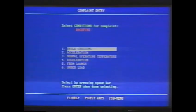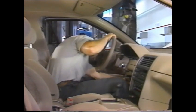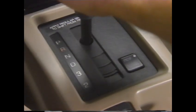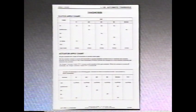actuators, and warning lamps. While the actuators can be checked using the service stall system, another quick and direct way to check their operation is by listening to them. Begin by grounding terminal B of the ALDL connector. Then, with the ignition key on and the engine off, you can move the gear selector through each position to check the actuators. Each actuator can be activated from a gear selector position.